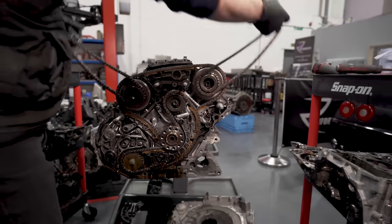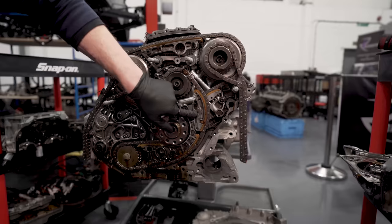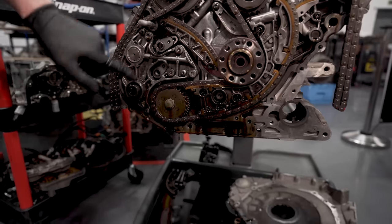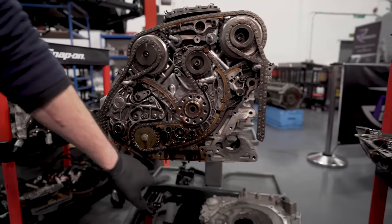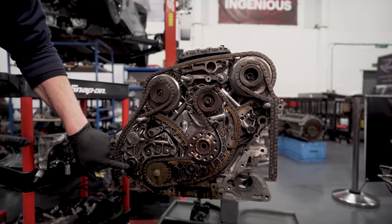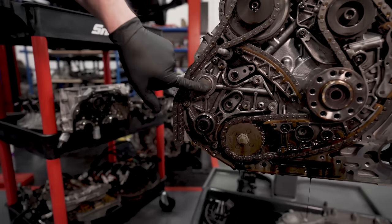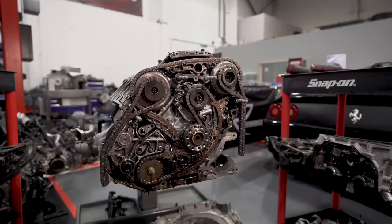That's how it would look. So you've got crankshaft, you've got center idler, tensioner, that's the oil pump drive gear, and that sprocket is bolted to the gear behind. The gear behind then drives the power steering drive, which is still there, but it's blocked off on the case because it's a Gen 2 or Huracan. It doesn't have hydraulic power steering, it's electronic power steering. So that's just blacked off on the rear timing case, but it is in there behind it. And then this one here is aircon drive. So that's the drive unit for the air conditioning drive shaft. Again, it's a race car, so you don't have that.